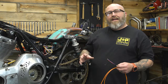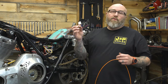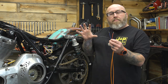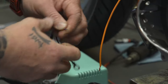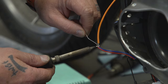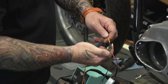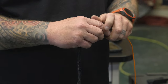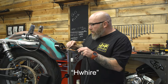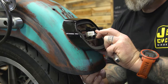The next thing we're working on is the tail light and brake light — it's actually going to be very simple. It's going to be one wire that we're going to run through this fender. I'm using a Custom Dynamics plug that plugs into a Custom Dynamics tail light, but basically you're going to have the same three wires on your tail. We have a ground, which I'm going to ground to the back of the fender where the tail light base mounts, and then we have our wires for our tail light and our brake light — we're actually going to put those together to our one wire. I'm going to run our wire inside a piece of casing because it's going on the inside of the fender and we want to keep it safe.